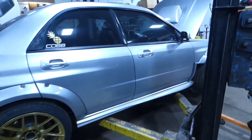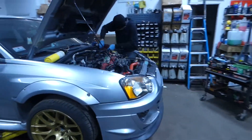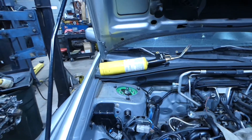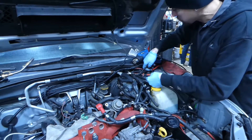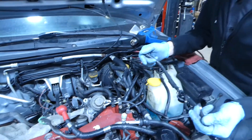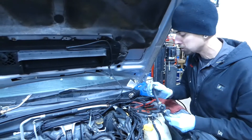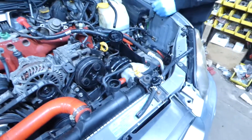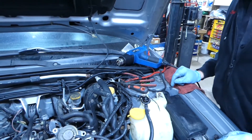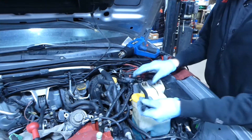Starting to smell a little fuel in the shop. Checking in on the guy in the next bay — he's got map gas and a heat gun going. The factory fuel lines have been on there for about 15 to 16 years and have gone through so many heat cycles that they've gone from rubber to plastic, so they really didn't want to come off. He used the heat gun to soften them up with a little lubrication behind them, got it on max setting, and they finally came off. Just finishing up the fuel lines and then that part will be done.